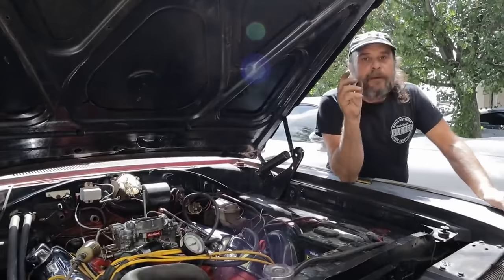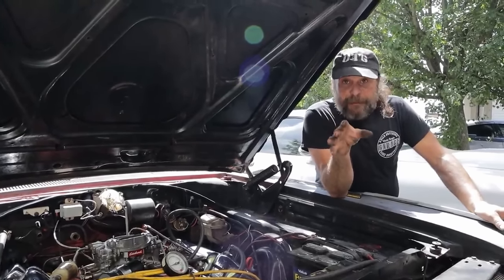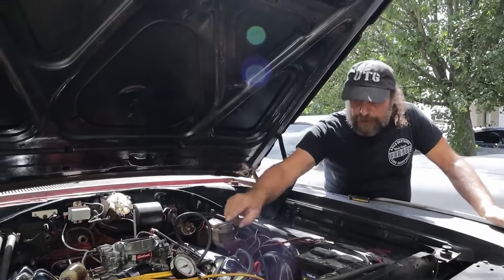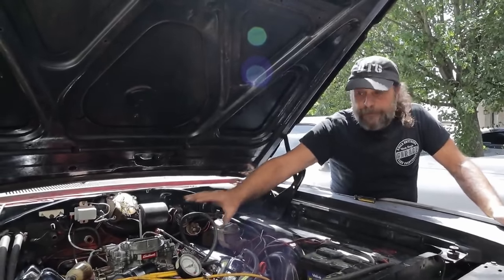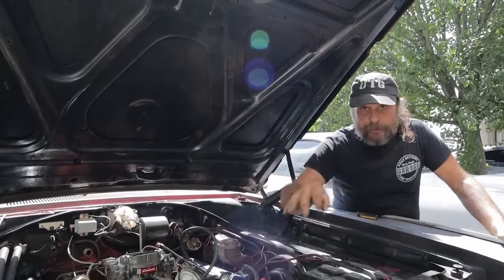So I did what any good friend would do and went on YouTube to try and find a video that would prove him wrong. To my surprise, a couple of the guys I watch on YouTube who are really good with older engines were also wrong. Uncle Tony's Garage said: 'Vacuum Advance — do you do it with ported vacuum or manifold vacuum? It's a very simple answer. When it's a direct connection between the distributor's Vacuum Advance and the carburetor, always ported. Never manifold, always ported.'